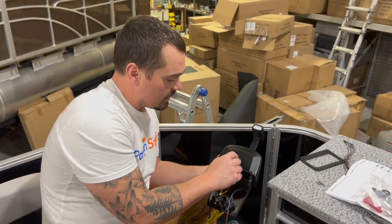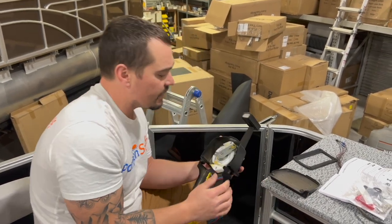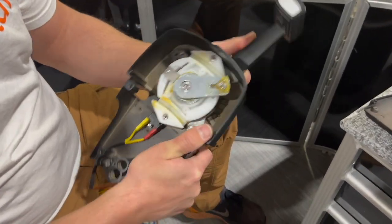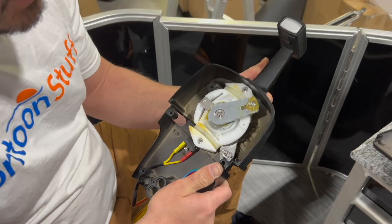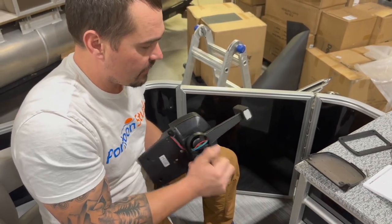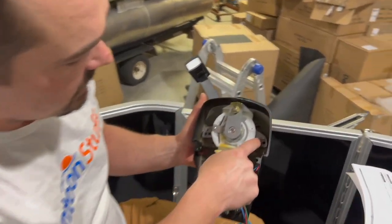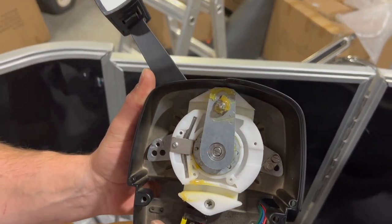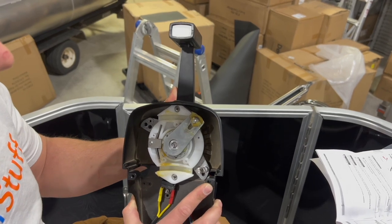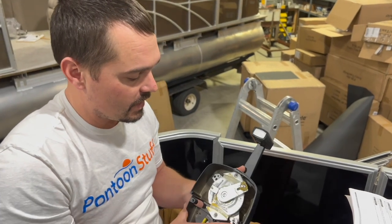One of the first things I did is I removed this back plate — just a couple of machine screws hold that in. I have to flip it because right now my throttle is push to throttle, meaning this is going to push my throttle, so we need to reverse that. We're going to pull our side cover off and open up the control box. You'll notice this is in the neutral position — these are my shift connections, this is my throttle connection. Neutral with a lever should be straight up and down, so we'll adjust that while pulling everything apart to change it to a pull throttle.